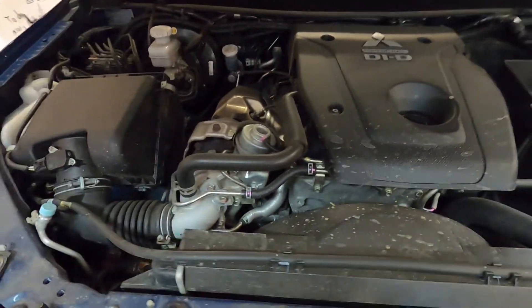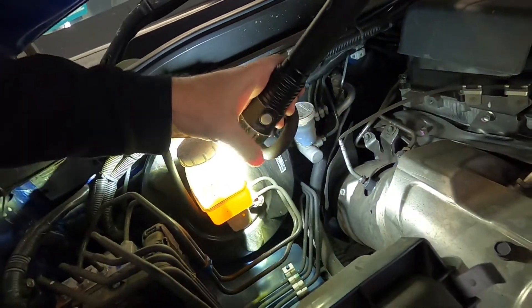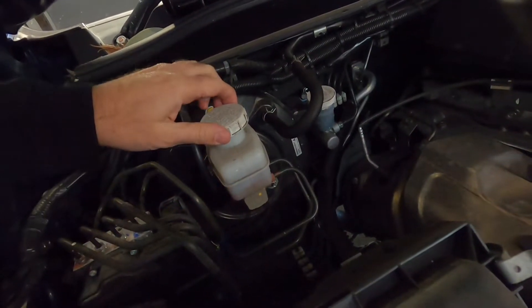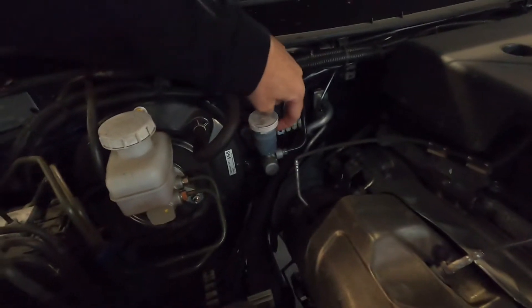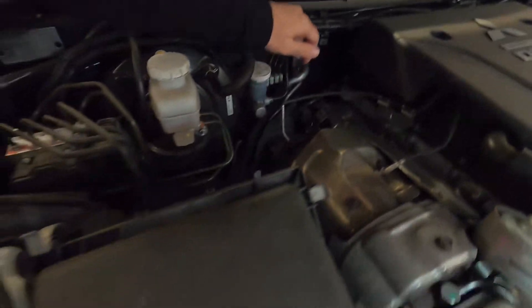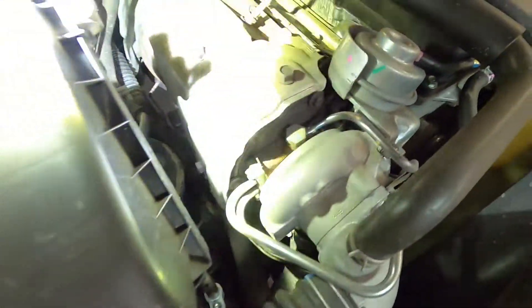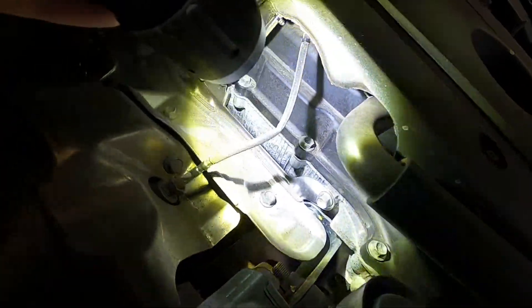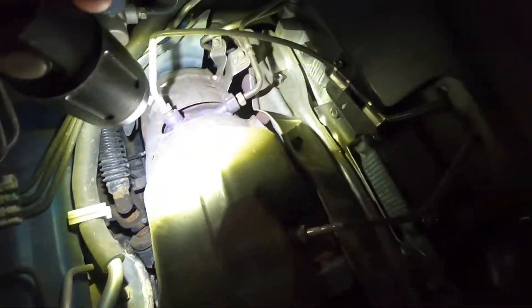First thing I like to do is just have a general look around and check our levels. Looking at our brake fluid - you can see it's quite high, which is good. Normally if your brake fluid is low it's only because the pads are worn, not generally because you've got a leak. Check your clutch fluid if you've got a manual. Your coolant level - just make sure it's on the upper level. Now have a look around your turbocharger, just make sure there's no oil leaks all around it and around the cylinder head.